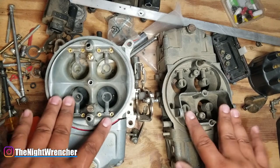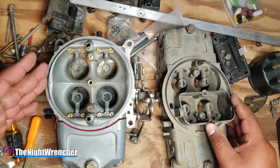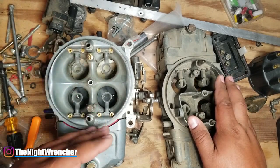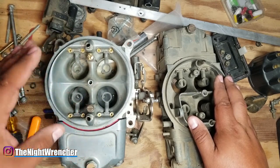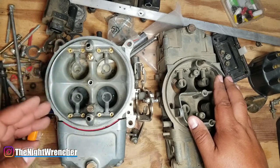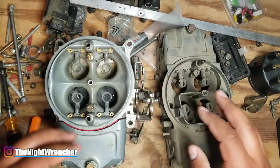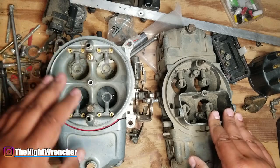In reality, neither of these carburetors are ready to see any kind of track time because we don't even know what engine they're supposed to be on. We have people buying two, three, four, five, six hundred dollar carburetors off the shelf, putting them on their engines, expecting them to go. And they start running into issues — starvation issues, running lean, running rich, popping issues, won't idle. And it's not because they chose the wrong carburetor CFM-wise, but because they didn't actually tune it for their particular application.